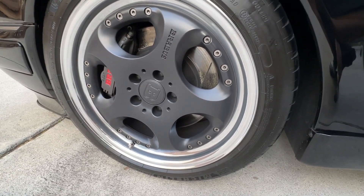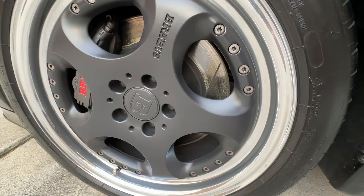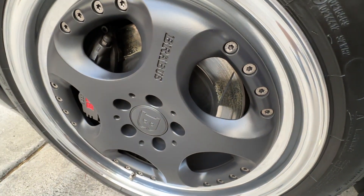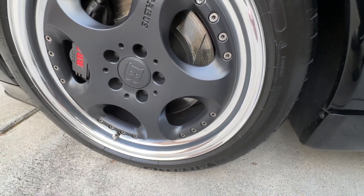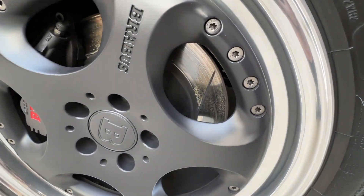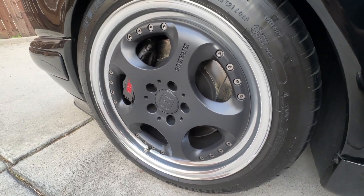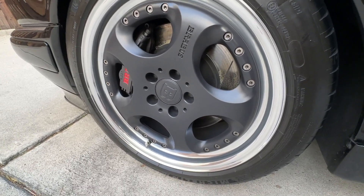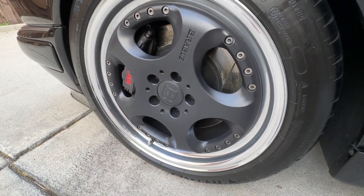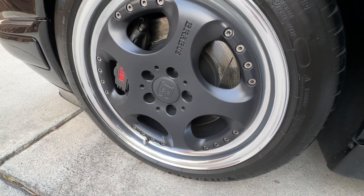Driving this around town, these brakes take a little time to warm up. But once they're warm, they're great — you can actually hear how much they're biting the rotor. They're a little noisy compared to other brakes. The first set of rotors this car had with sub 40,000 miles were severely lipped — way under minimum from what I heard, and this car is almost at 60,000 now with new rotors. The combination of pads and rotors is very aggressive, which is great for high performance driving — the design of this car going 200 miles an hour. But just driving around town, I personally like my Akebono brake pads on my E55 with OEM rotors way better, just for around town driving. However, these do look extremely cool — they are four-piston versus the E55's two, and fixed versus floating.